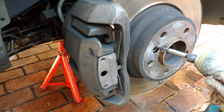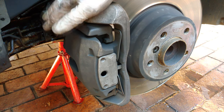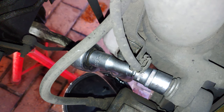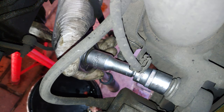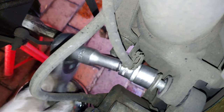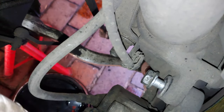Put the hex screw back gently, then release the brake caliper — it's size 18 and pretty tight. There's one bolt at the bottom and another at the top. I have a container here which will provide support when I release the caliper. Support the caliper from the bottom as you remove the last bolt, then rest the whole caliper assembly on that container.